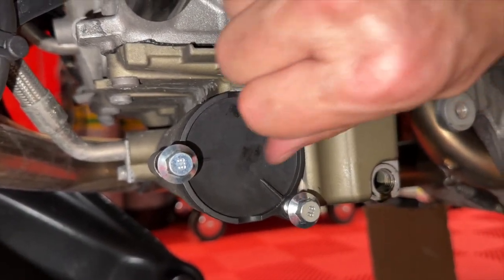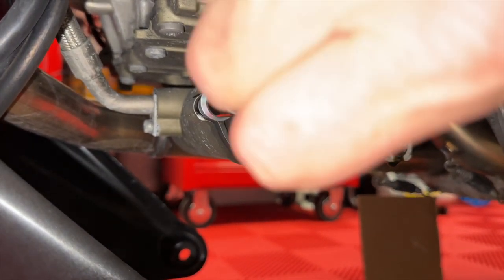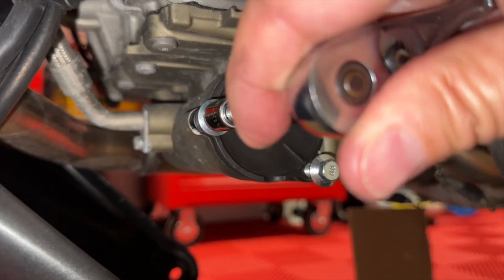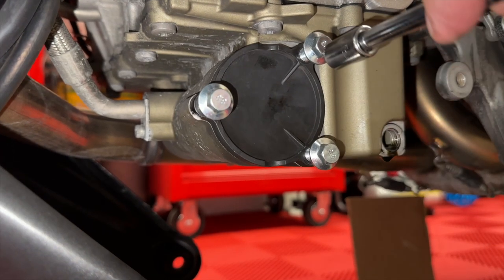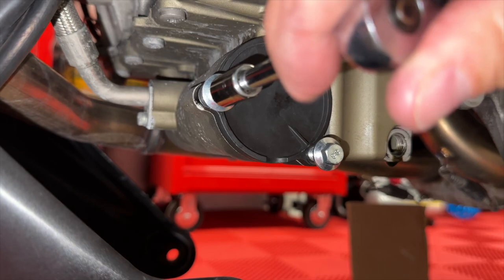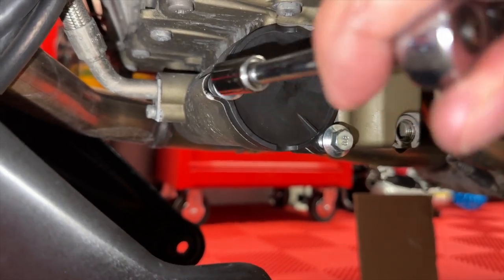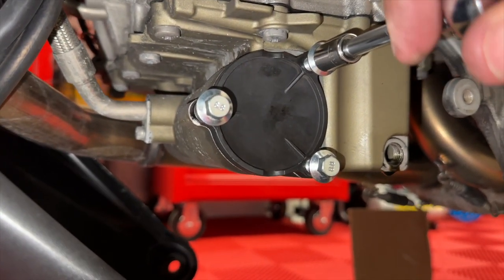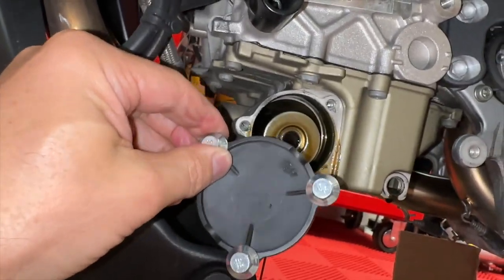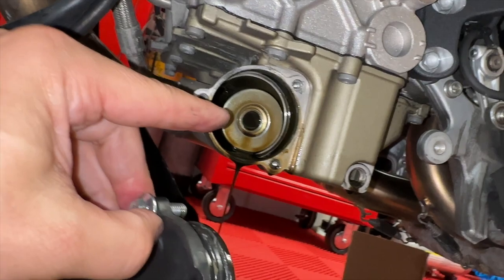This will push against the body here and slowly push this off so I can pull it off. I'm just going to rotate with very minor pressure. People are going to say you're going to mar up the surface — there is a double O-ring on this filter cover, so we just don't want to create any problems. If Ducati has a special tool for this, that would be great, but I've done this before on the V4S — just enough to get some separation so the cap will just come right off. Then it'll look like this when you pull it off, and we'll clean it up and get these two O-rings changed and get that filter out.